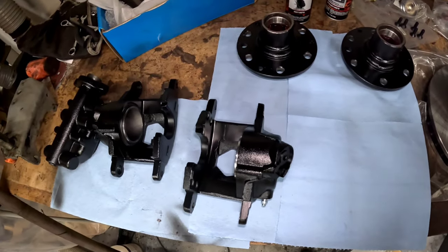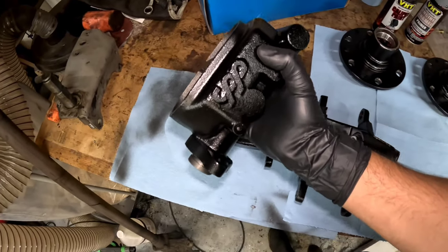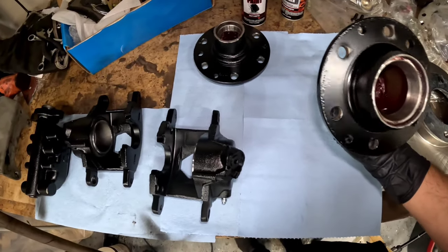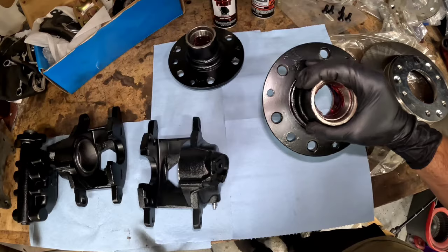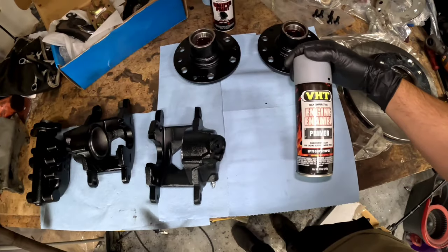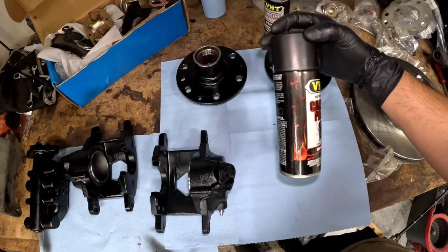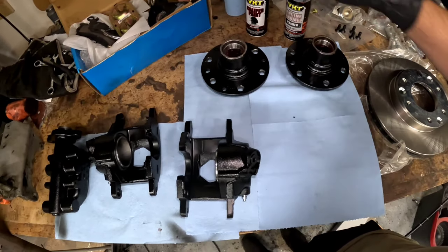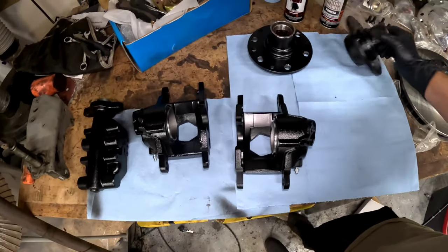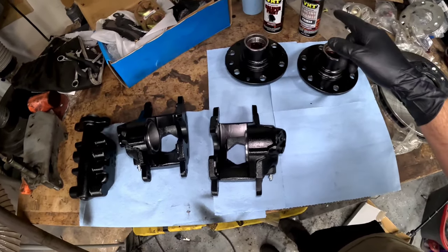Just like that, it's done. All the calipers and brake master cylinder look awesome — nice CPP logo, turned out great. What I used was VHT engine enamel primer — it's high temp — and their caliper paint in satin black, which has been our whole chassis theme. I rattle-canned it instead of using the HVLP for smaller projects. You can get pretty good results with rattle can as long as you prime, prep the surface, and give it proper dry time. This is actually the next morning.